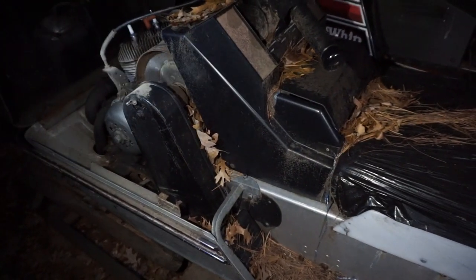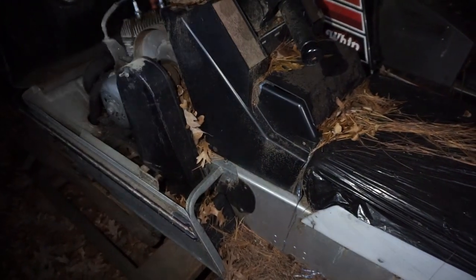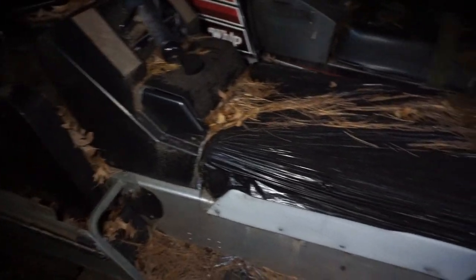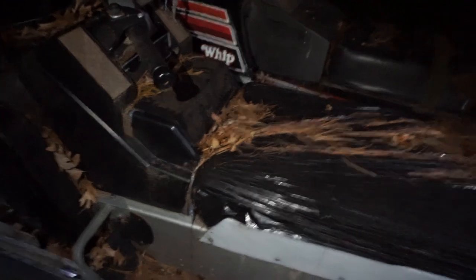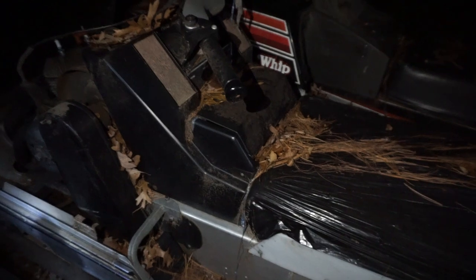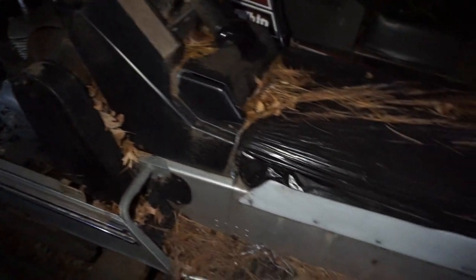But yeah, the motor was locked up. It had been freed up before. When it first came around here, we had it running with priming the carb and put a little fresh mixed gas in, but it didn't seem to want to pump it through. And I'm like, I really don't want to go through and see if I got a plugged line, whatever. So I kind of put it on the side. But that one I did go through and it did run. That thing went pretty good, and I didn't want to open it up because with the new piston in it, you don't want to go crunch. Yeah, that'd be bad. I've seen a lot of people do that. They rebuild something, and then they think they can go full bore on it and end up going crunch again, because they didn't do their break in. So they broke it in.